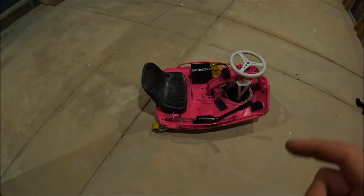All right, so for the headset, it takes a little bit more tinkering to install. Not necessarily that it's difficult, you just have to remove a few parts. So you do have to take off this Allen key on the steering wheel here to actually take the steering wheel off of the cart. And then the two nuts here, I have these here just in case. You really only need one with a sealed headset bearing. One of these nuts will tighten it down enough for it not to come loose.